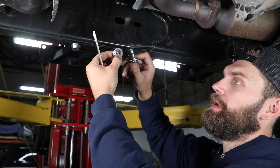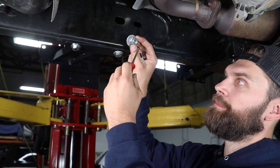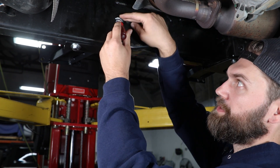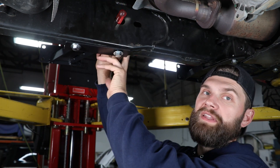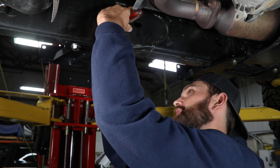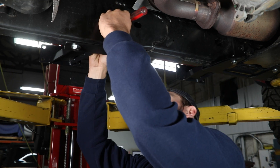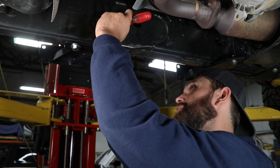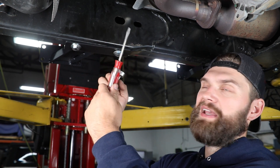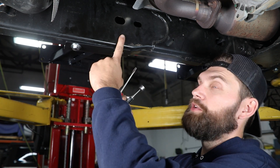For the forward-most bolt on the outside of the frame, you're going to use a half-inch by inch-and-a-half-long bolt, and on the inside you're going to have to feed a washer and a nut through this hole. A good tip is just sliding those on a screwdriver and then feeding it up through here — angle your screwdriver up so you don't drop them — then push all the way out through the hole on the outside of the frame. Applying pressure against the back side of the nut and washer, slowly feed the bolt into place from the outside, carefully feeling to make sure you're getting them lined up, and begin to get that nut threaded into place. This part isn't necessarily difficult but it is a little tedious. You can also use a magnet to help feed those into place if you have one available.